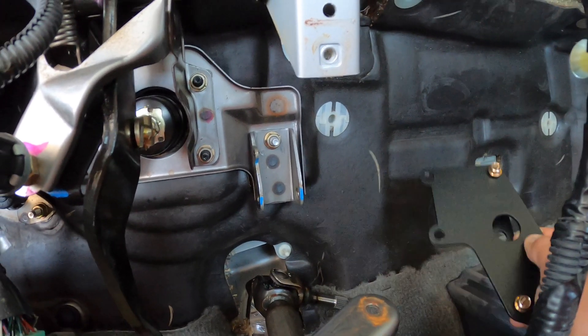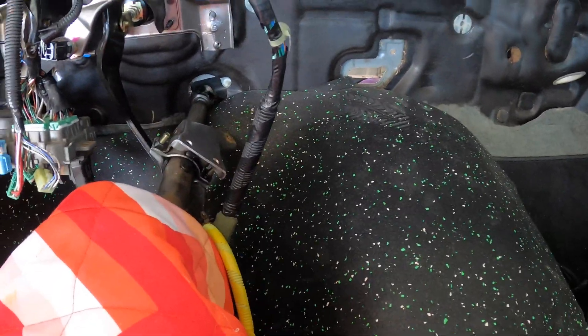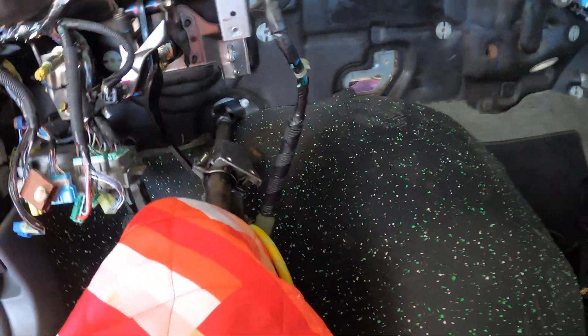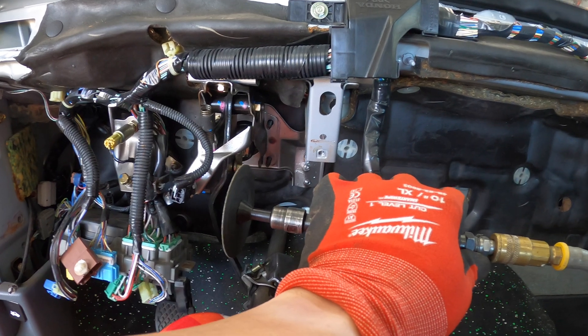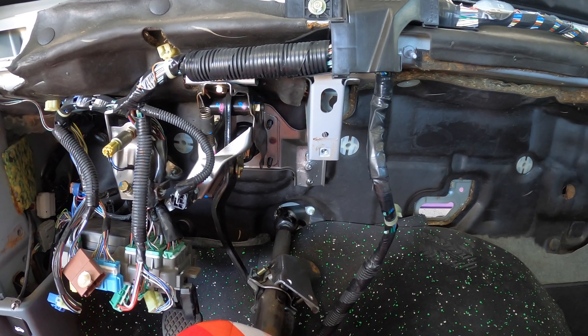Going to tackle this bracket now. I've got my safety eye gear on because we're using a pneumatic air cutoff wheel. I have a pressurized bottle of water, a fire extinguisher, and rubber matting to protect the carpet. Luckily the wheel is spinning in the right direction — sparks should go back and down rather than in my face. It's an awkward angle and I'm left-handed, so I'll take my time, let the bit do the work, and hopefully the outcome is positive.